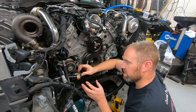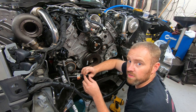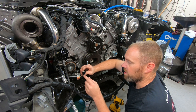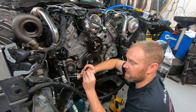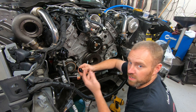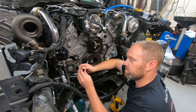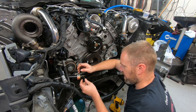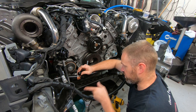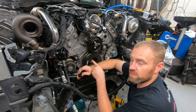A couple more tips: if you ever have to pull this motor out or do any work in the area where the AN fittings are removed, be sure to put a plug cap on here, because if you damage the tapered part of the fitting it'll start to leak. And since you've glued it in permanently, that could really screw you and you'd probably have to get another pan. So do whatever you can to protect the tapered part of this fitting. Also, once you get the first one in, go ahead and put a cap on it so you have maximum pressure in the crankcase when you drill out for the second one as well.